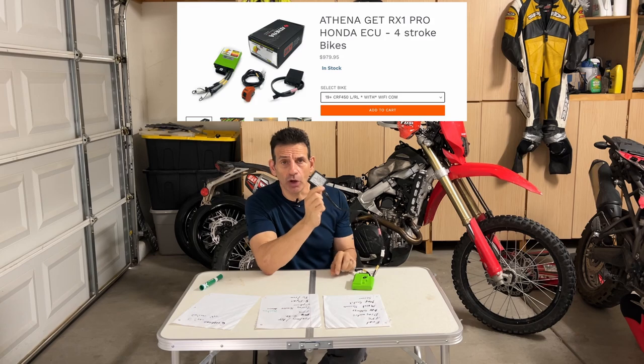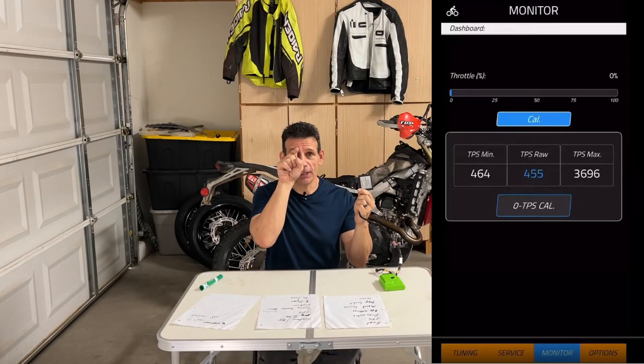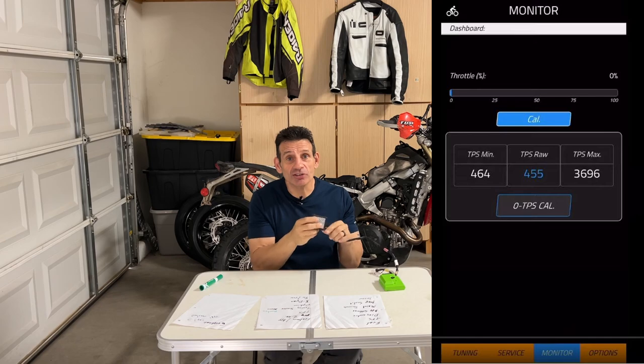One reason is something like the TPS. If you've ever seen videos of the Vortex and even the AIM, just to set your TPS and calibrate your ECU — if you don't do it, the bike's still going to run fine. But if you want more out of your ECU since you're paying the money, it's not the hardest job with the others: put a little wire in there, hook it at your battery, hit the switch. Anybody can do it. But it's right there on the cusp where a procrastinator could put it off. Here though — no problem. You just go into the app, hit calibrate, and it's done.